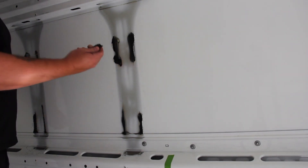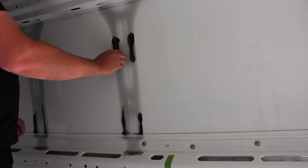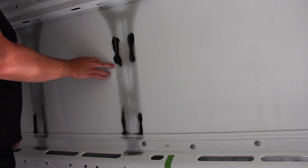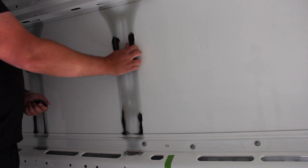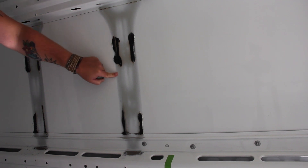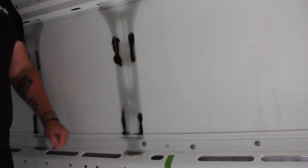The stuff the factory used is almost like foam, so I'm not sure how well it was sticking these panels. You've seen how easily one came off — and a couple were trickier — but the way it just comes off with your fingers means it doesn't give great adhesion. As the van moves around, the panel flexes, which is why these Peugeot Boxers, Relays, and Ducatos are so boomy when you drive them. These ribs are meant for strengthening and sound deadening, but I don't think they're doing a lot. Hence why I'm going to re-seal them all and make sure we've got good adhesion between the panels and the supports.